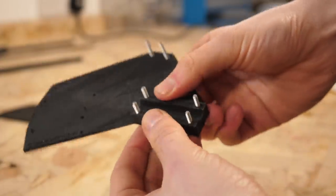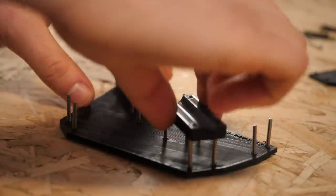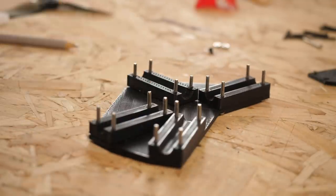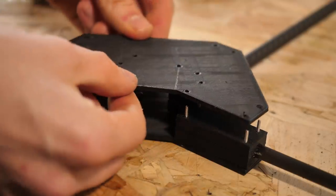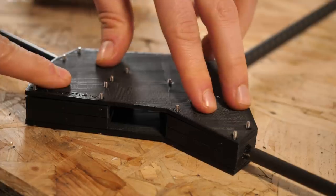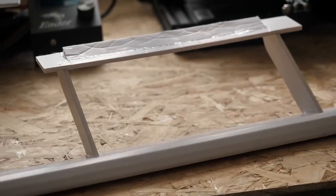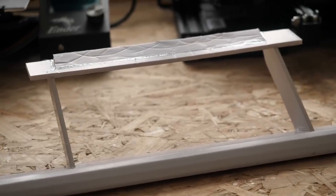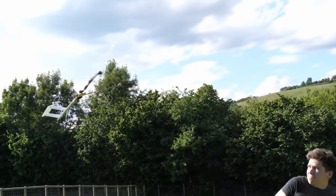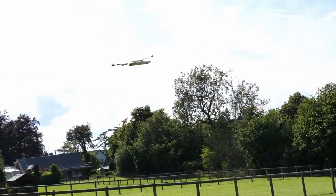These spacers grip down securely on the arms when the bolts are tightened. I can also change the position of the motor arm to see if this has an effect on the flight performance, although for now I just wanted to get the machine flying optimally in a standard configuration before breaking it doing something silly. A wing was cut from lightweight depron. The previous helicopter featured a fixed stabiliser wing, but after reading a little online, it seemed a stabiliser of this sort was a little unnecessary, so I did without it.